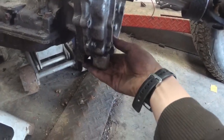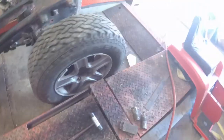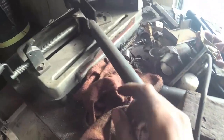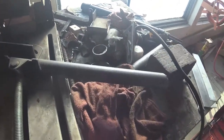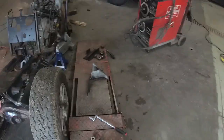Right now what I am doing — the motor's just sitting here, I haven't made mounts yet. I'm making the mount for down on the bottom of the transmission. This flat piece here, there's four bolts here. We're going to be running a tube down that goes to flat and then back up the other side. I think it's one and three-eighths tube. This stuff's closer to eighth-inch wall — it's fine, it's going to be plenty strong. I'm going to make two tubes with an angle, then put a flat plate on the bottom to bolt to the tranny. Then I'll make — I'm going to get some U-channel, kind of like the factory motor mounts were, to do the two front motor mounts. That's probably all we're going to do for motor mounts.